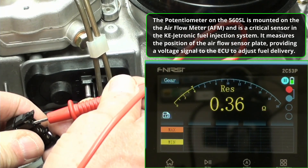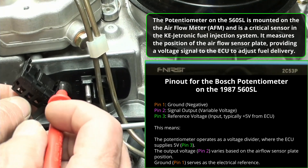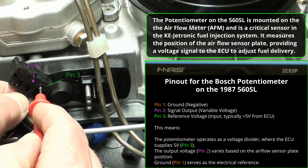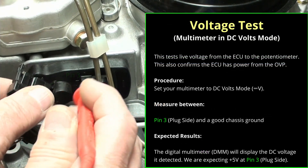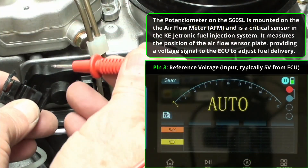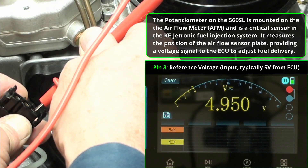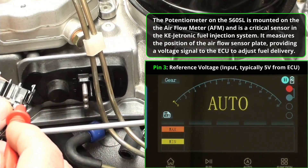I have my multimeter connected. As the potentiometer does its thing, that's going to be fed through here, and we're going to have 5 volts through here. We have to turn the ignition on first to see that, and I need to change my settings. I'm in auto mode — let's check it and see how it works. Look at that: 4.95. So now we know we have our 5 volts coming in.